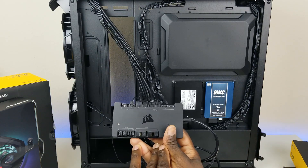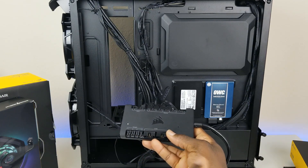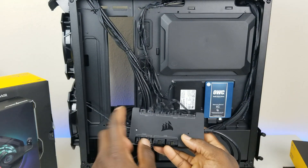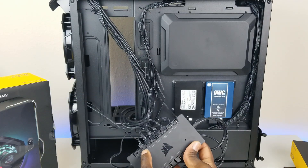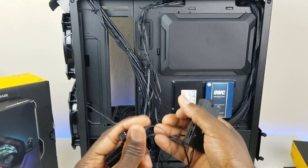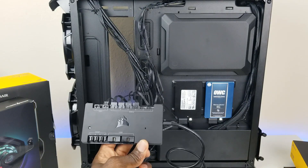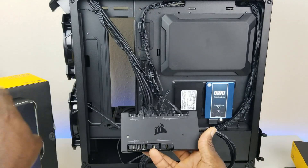On top you have individual fan ports — six ports, one through six. You want to run fans in sequence, because some lighting effects will be off if you don't. So I'll have them numbered one through six in order. Further down you have LED controls for the fans as well. On the Commander Pro I also have a fan splitter connected in port one — you still have to supply power to it, and then it connects to the Commander Pro. That's the basic overview — the Commander Pro lets you control your lights and fans via software once the PC is built.